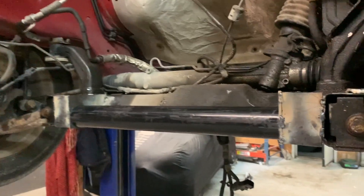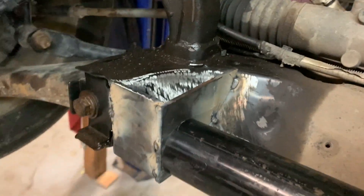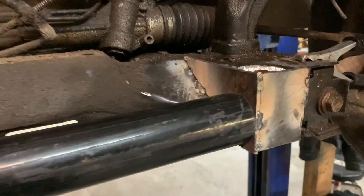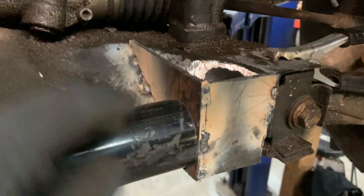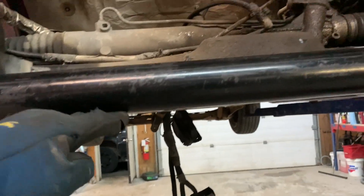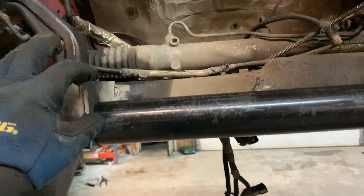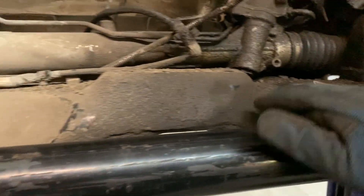That is a tight fit. Very tight fit — you can see now why I did this. It makes it way easier. Just cut your pipe off nice and straight, nothing to it, and just weld the sucker in. Now obviously I'm not done — I have to cap in the top and bottom, finish weld all this stuff. But I want to get an idea of what I'm looking at here. It's basically flush with the bottom of the crossmember as it sits. We're about an inch, inch and a quarter lower than we would be — so that's good. And lots of room to make up mounting brackets all around here for the rack.